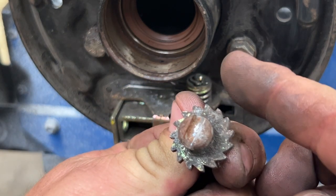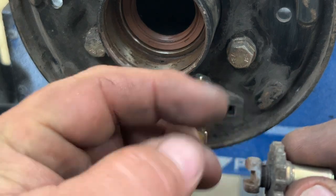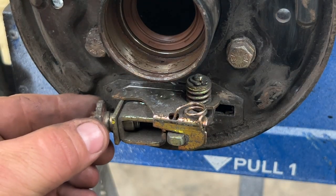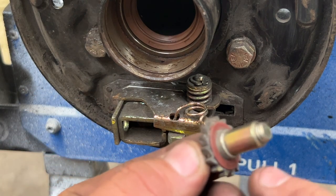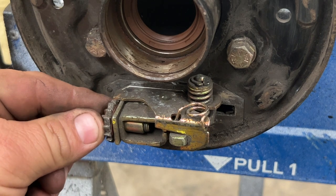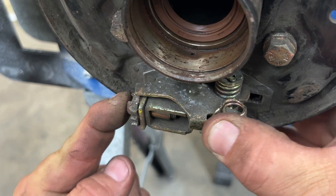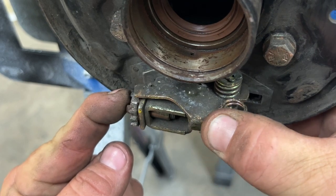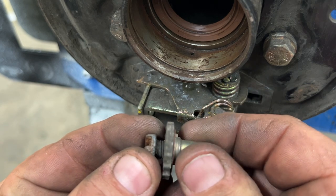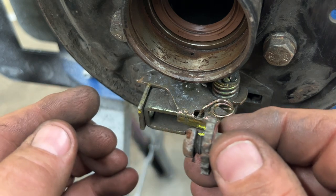See how the teeth are facing one way? On the opposite side of the rear end, the teeth are facing the opposite way. And you have a screw in here — when turning to the right, we're tightening it up. This auto adjuster fits into this little slot here. Once you press on the brake pedal and pull that lever towards the golf cart, this is pushing that little gear out. The screw here is on the bottom of the brake shoe, and what it does is push the brake shoe away. As the pad wears down, this is pressed outward, allowing you to stop better each and every time.